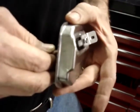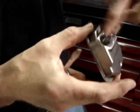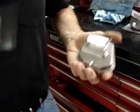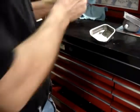This hole is simply a reed valve. In order for this fuel kit to work properly, we need to remove this reed valve from this area and install a new reed valve further down the line, because we want to be able to take advantage of the pulse wave in the crankcases and use that to drive the fuel pump that's included in the kit. Go ahead and take a break for a moment.